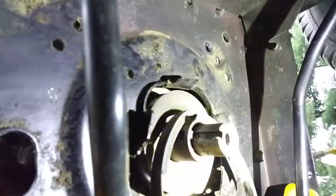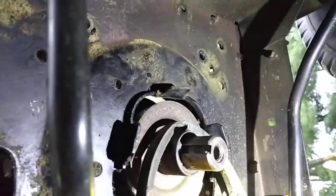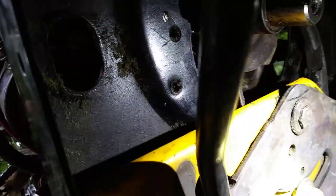The problem is there's not clearance to get the pulley out of the way to get the belt off. However, if you take the engine bolts off — you can see them there, they're at the four corners. This one's kind of a pain back in here because it's back underneath, so you've got to get a little angle box wrench into there.